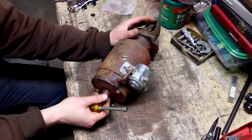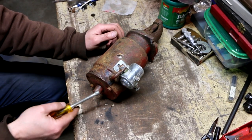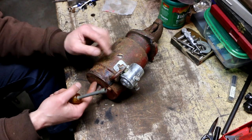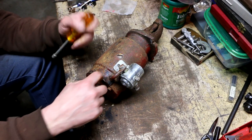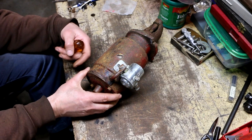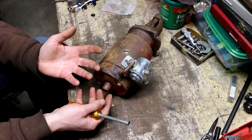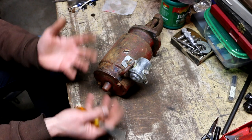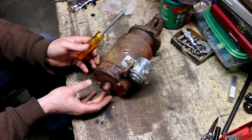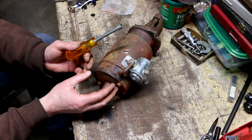I've got the starter here on the bench and I'm going to take this back cover off. What I expect to see in here are the brushes, and what I'm suspecting happened is water intrusion got in through here. This is going to be all corroded and a mess inside — rust, iron oxide, it's conductive. There could actually be enough rust in here that's causing the short, and what would be wonderful would be if I was actually able to take this apart.